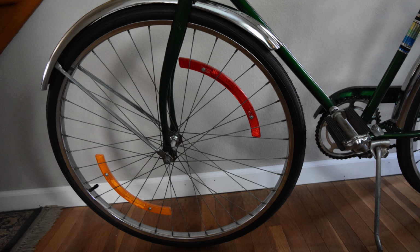But a lot of forks have a little bit of push that moves that front wheel out a little bit. And remember, anytime the fork curves or it's got gussets and it moves the wheel away from the fork, that's supposed to be forward. Anytime there's a brake mounted on the front fork, that's supposed to be on the outside of the fork. Little bit of a common mistake. If you go to pull that bike out of a box, brand new, look at that front fork, look at the pictures of the bike, and make sure that you have it looking exactly like the photograph. And look at the photograph. Sometimes the drawings they put in the assembly instructions are terrible.